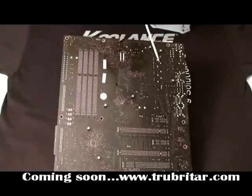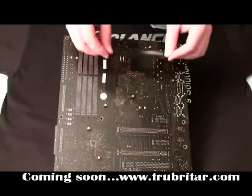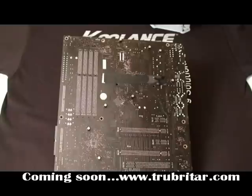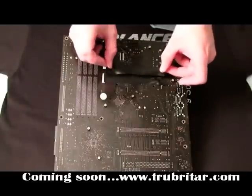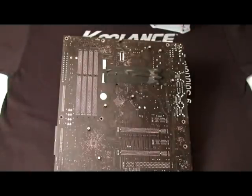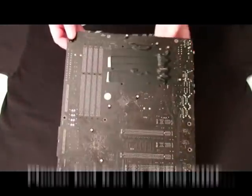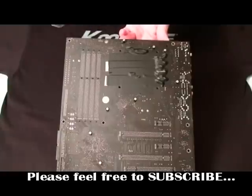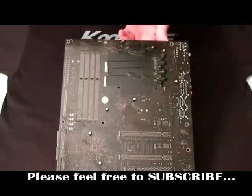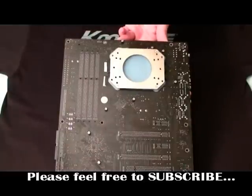If you notice there's a lot of soldering points on the back of the board. I tend to be a little overly cautious and install some black electrical tape on there just to give us a little extra insulation. When you've completed installing your insulation tape, you should be ready to install your motherboard back plate and tension screws. Gently line it up with the four holes and pop it through. When you've installed this, you're ready to turn the motherboard over.